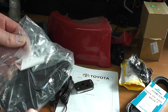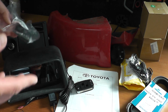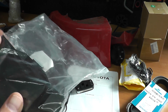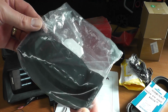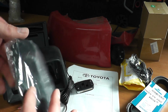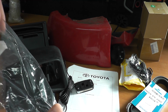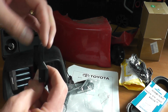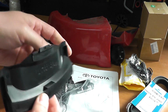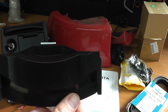So this item here, if you have a look underneath the car towards the back of the car, and you can see your flywheel, which you obviously shouldn't be able to, that's because you're missing this plastic part here. If you need the part number, that's the part number for the flywheel cover. It's a small plastic shroud. We'll open it up, and all this does is, using these guides here, it just slides up into its housing in front of the flywheel where you can see, and that's it. That is the flywheel inspection cover.